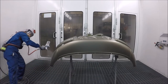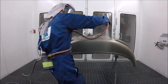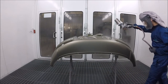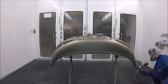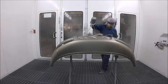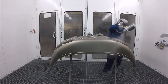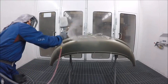On the bumper as well — nice big fan, and you can see how far away I am. If you see wet spots, you're putting it on too wet. You want to see it go dull — not wet — or else you'll get mottling. You only want to put it on wet when you're trying to get coverage. For a control coat or drop coat, stay away and move a little quicker to get the effect you want.